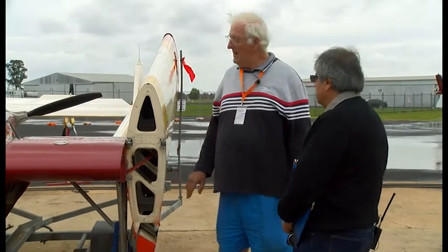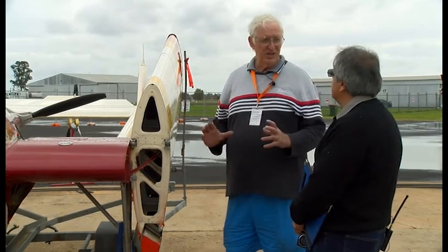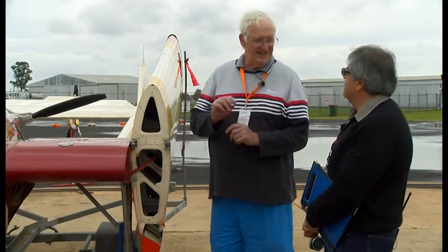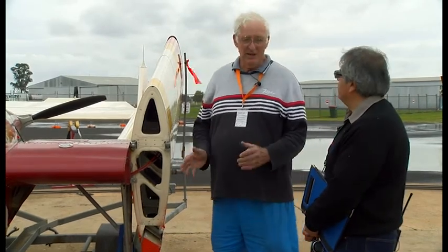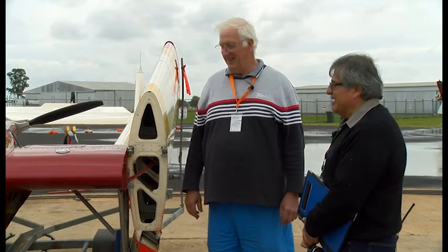What sort of engine has it got? This is a beautiful four-stroke two-cylinder engine by HKS company in Japan — the same company that builds all those beautiful HKS turbochargers you see on show cars. They build an absolutely beautiful motor, though they're a little bit hard to get. There are different motor options — we also fit a Rotax 447, which is what it was certified with. We're also looking at putting a Rotax 912 in it, which is 80 horsepower, so that should make it really go around.